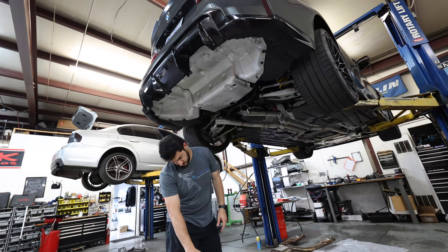Right now we just have to put the center brace back on. We're actually going to add some washers because it looks like it touches a little bit right here, just to make sure it doesn't touch at all — which is pretty common on aftermarket exhausts. Then we just have to put the tips on and we'll be ready to go. As you can see, there are Allen bolts on both sides, so you'll need an Allen key to put the tips on.